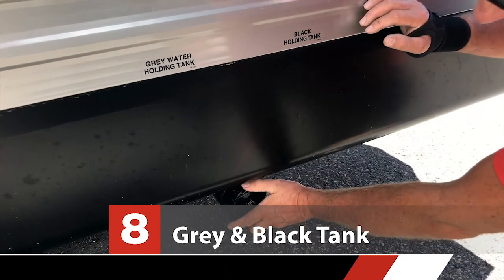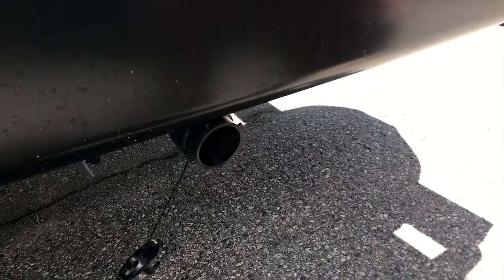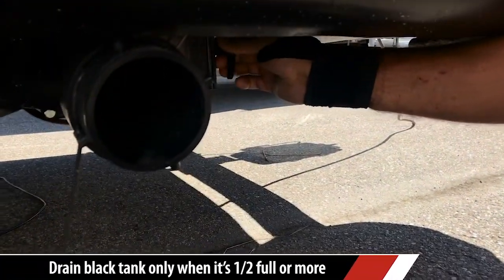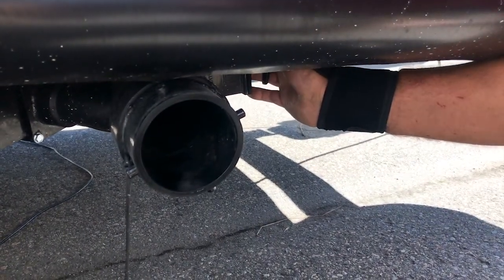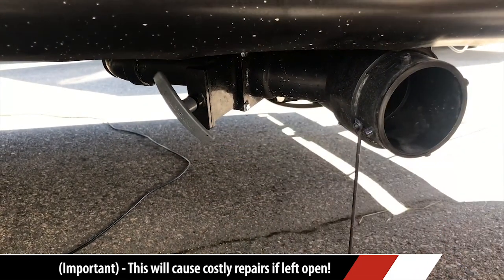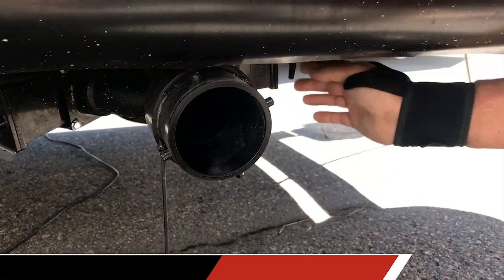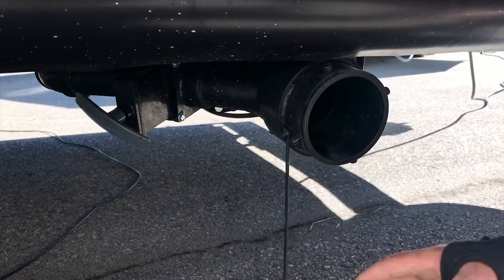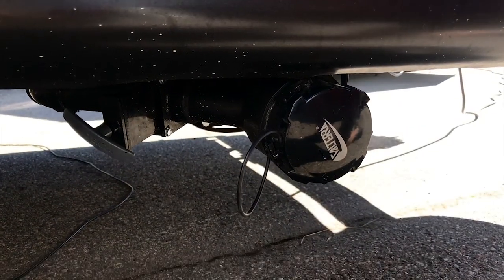Here's your sewer connection. By taking this cap off, you're going to hook your sewer pipe up here and then it goes down into the ground. You have your black holding tank over here — clearly marked with this label — and you're going to pull that out and let the sewage run out until it stops. Then close that off. Then open the grey valve and let the dirty soapy water in your grey tank clean out your sewer hose. Once that's done, close that up, open the sewer flush again to flush out your black tank. Once everything has stopped running, close it up and then go inside and charge your toilet with more chemical.